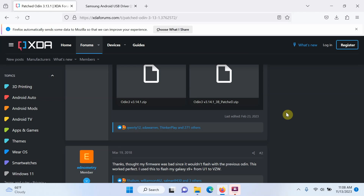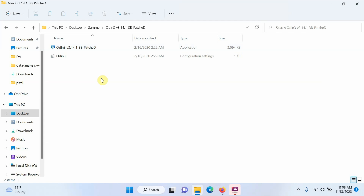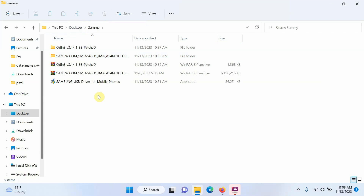One important thing to keep in mind: if your device has two variants — Snapdragon and Exynos — you cannot cross flash between them. Exynos-based Samsung devices can only cross flash Exynos-based firmwares, and the same applies to Qualcomm. The firmware itself is downloaded from a specific website — links are in the description. Both Odin and the firmware were zip files; just right-click and select Extract All.